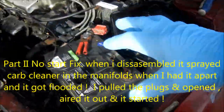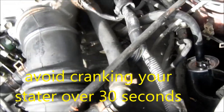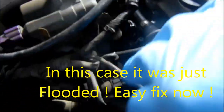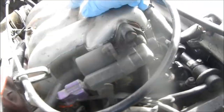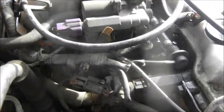Okay, here it is. I've got the charger on because I've been cranking a bit. I did put a new starter in about four or five months ago. All the fittings are torqued down so it should have a good seal. I noticed this fuel pressure regulator line here — it's soft rubber and checks the vacuum on the intake manifold to adjust fuel pressure accordingly. I put this new injector in on number two because the other one was dead — no continuity on it.